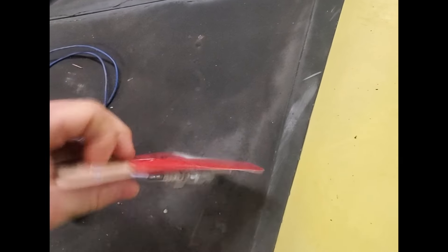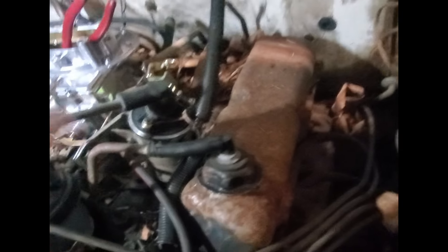Yeah, it's just orange. I have a brand new test plug right here. Got our new test plug in, let's watch. I'm just going to go ahead and say that spark is weak. So I found a coil, hooked it back up, going to test it again. I hope it doesn't fire off, but I also hope that it fires off. Let's see.